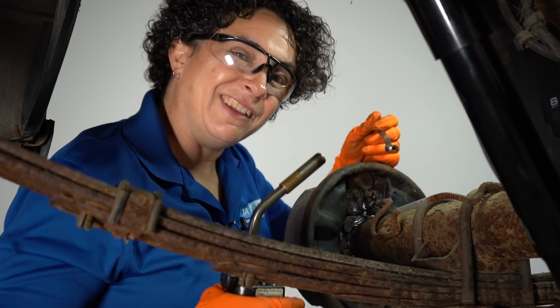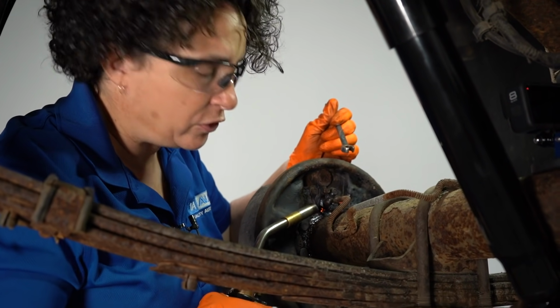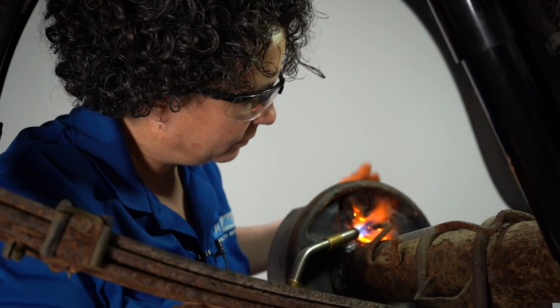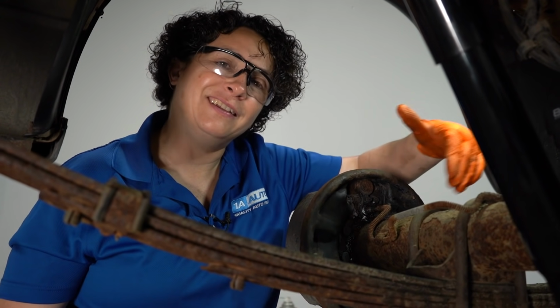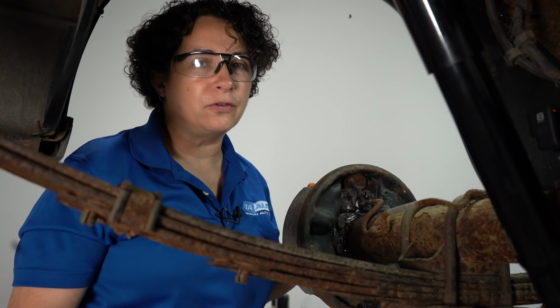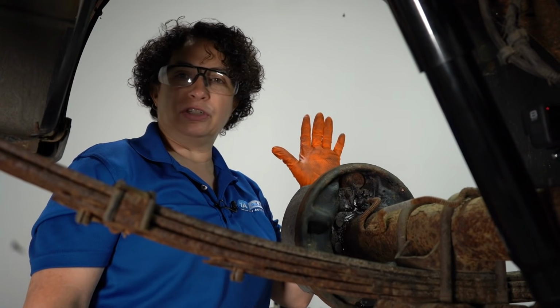So yeah, a little bit of heat after you penetrate spray, but you've got to concentrate. Make sure you get the area. Sometimes you do need to use heat to get the steel line out of the wheel cylinder, but don't forget, if you heat up that wheel cylinder too long, the seals blow just like a New Year's Eve celebration.